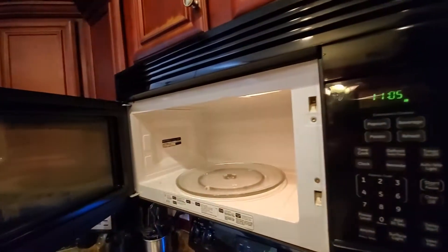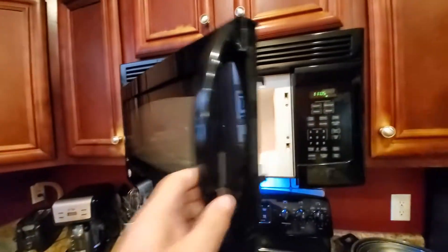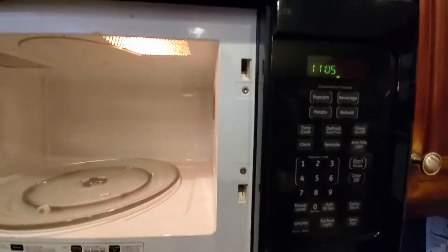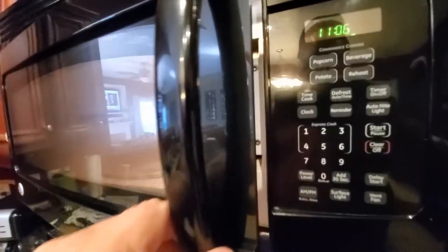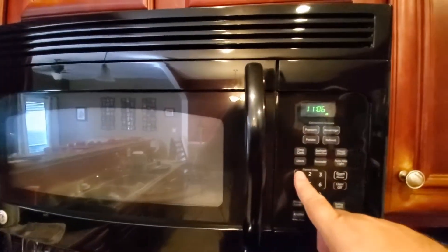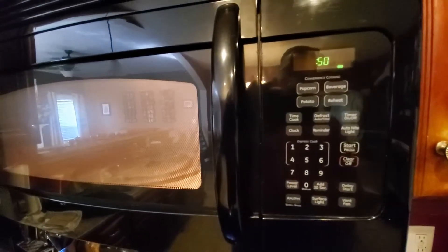We got a GE microwave oven here — pretty standard over-the-range oven. You can see the model number and data: this one is October 2007, so it's about 14 years old. Basically it turns on but nothing happens, so it really doesn't turn on — it just thinks it is. You've got these door switch receivers here and these little hooks on the door that go into those holes, and that tells it the door is closed and everything's ready to cook. If I press the quick express cook button, the light comes on and the timer starts counting down, but nothing's happening in there — it's not running at all, it just thinks it is.